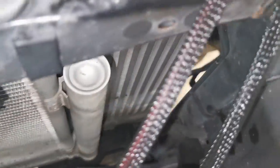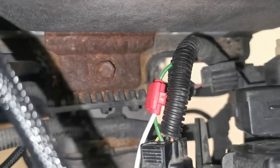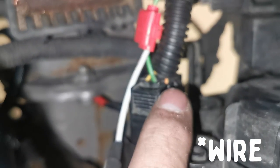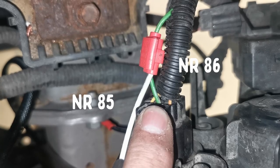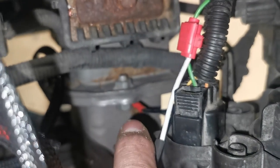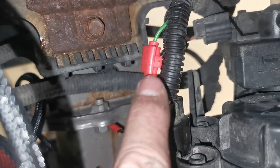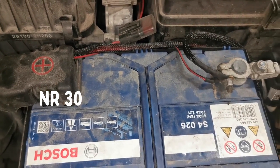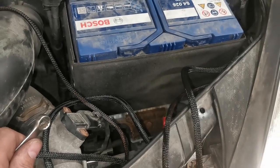All the wires are a little loose at the moment but everything's wired in and they'll get tidied up in a few minutes. What we've done is connect to the green cable — the main beam signal — which is the middle of three cables in the top connector. That's where we connected in. Down at the bottom we took the earth from the bolt on the beam. The cables for power come around the side of the battery with the minus and plus connected there. That's it ready to go — just need cable ties to make it neat.